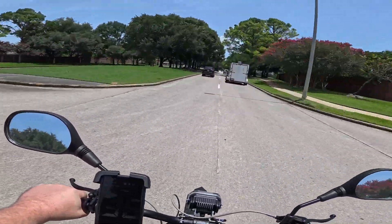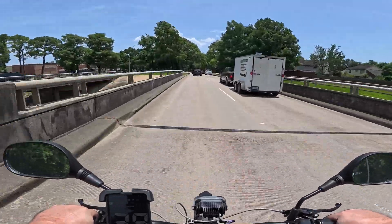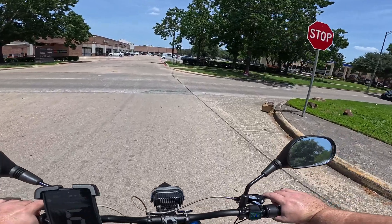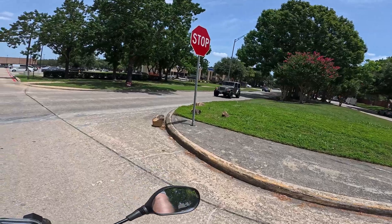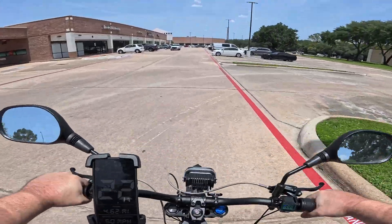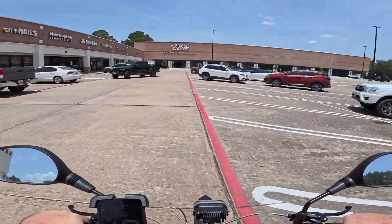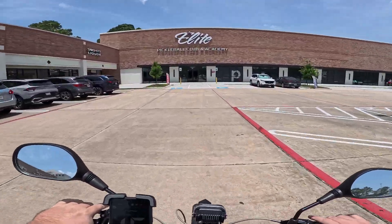So if you're looking into one of these bikes, I would highly recommend not getting the 2.5T unless you really want the high top speed. I would recommend at least a 3.5T or a 4T so you get that torque. When they come tuned, they're tuned way down — you can turn the phase amps way up. They have everything set to eco, and you have to get in there and really change the throttle response and stuff like that to get it to feel sporty and good.